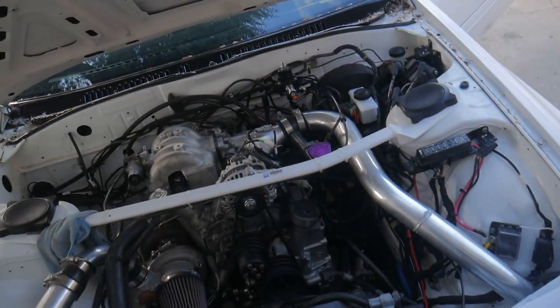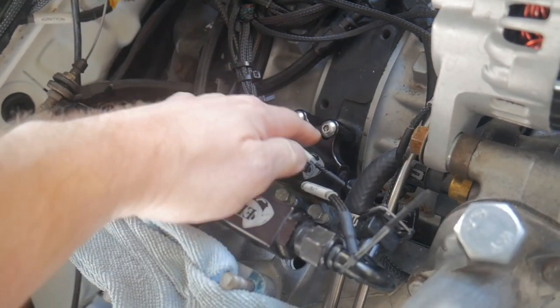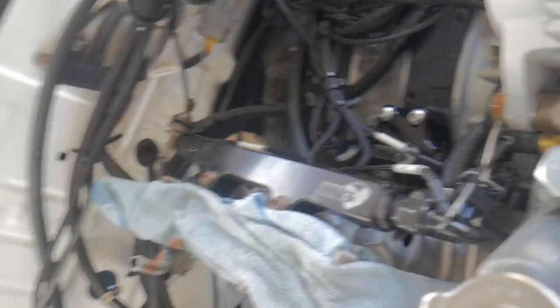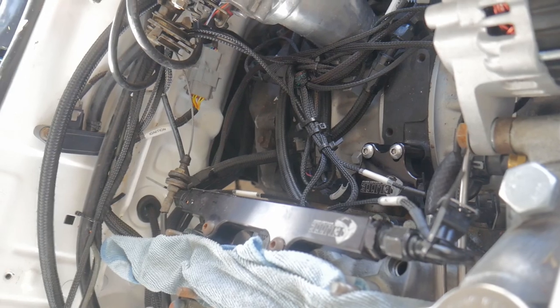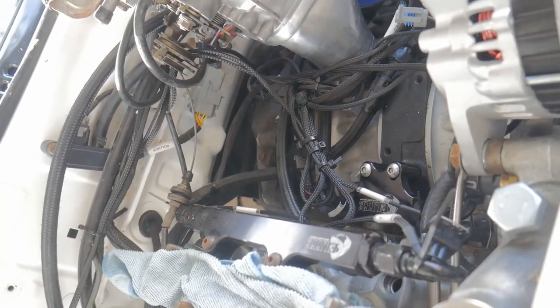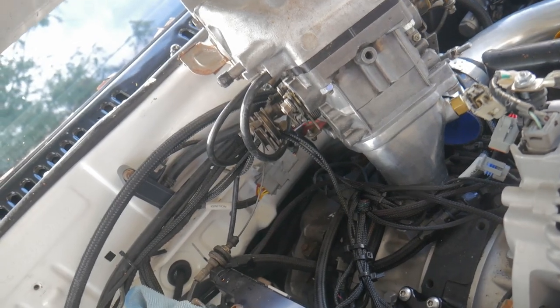This project is going to take a couple days because I'm still waiting for some fittings for the fuel lines and the injectors to arrive, but I'll go ahead and get started. I need to make a bracket for that fuel filter and get some other pieces started. Let's open up the FC. Here we have our Elite Rotary primary and secondary fuel rails. We're going to pull these off — there are no injectors in them — and I need to run some clean fuel through there without the injectors just to clean out the fuel system. Probably going to run at least a few gallons through everything to get it flushed out.